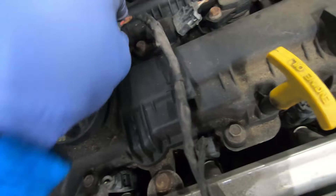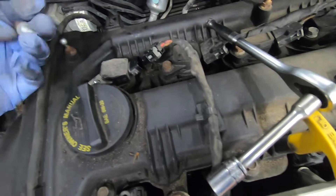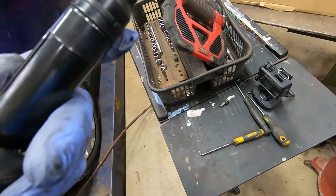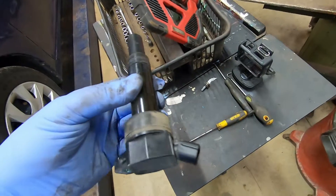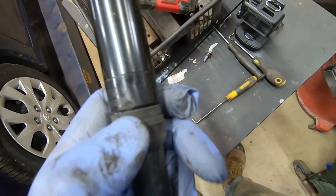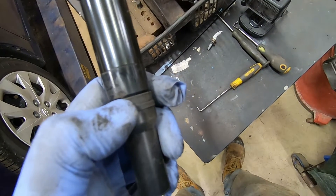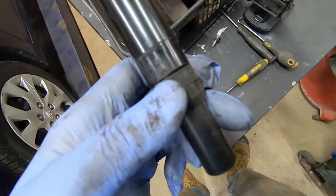These connectors get really fragile as the vehicle gets older — this one already has a broken connector. So let's take that out, get the bolt out, and with a little twisting motion it should come right up. With an ignition coil, it's sometimes possible to see cracking and warping. I don't see that right now, but this coil is definitely bad. Upon closer inspection, right above my thumb there's a burnt part on the high-voltage side of the coil. I suspect that's where the spark is leaving and not going through the spark plug — it's probably going direct to the block. It's charred right there, but it doesn't take much. That's where this thing has failed.